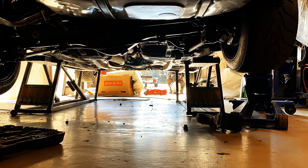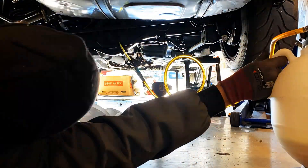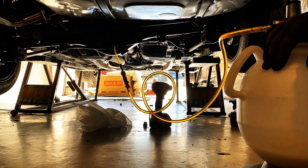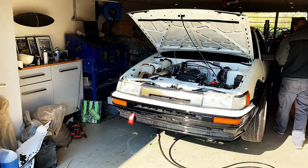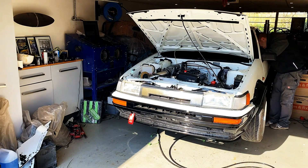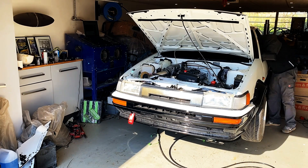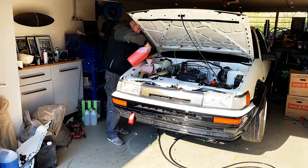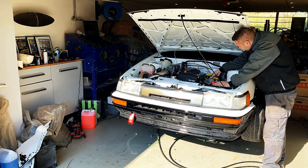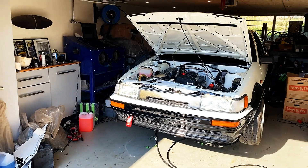I had a few jobs to do before I could drive it. One of them was filling up the rear diff — it only had about a quart in it — so I filled it up and tilted the axle. That's the shortcut to getting about half a quart more in there than usual, just to overfill it a bit; it's an old trick on these cars. With that done, the only thing left was to make sure there were no leaks, coolant was present, and stuff like that. Ran the entire checklist, got everything buttoned up, and got it ready for taking its first drive.